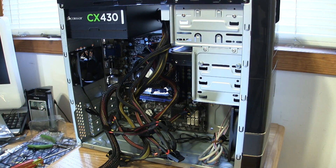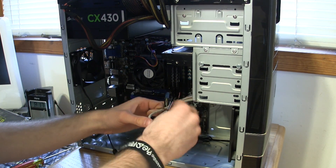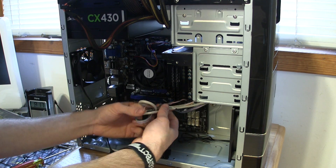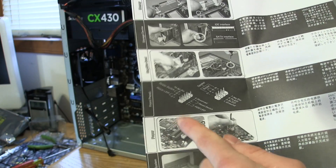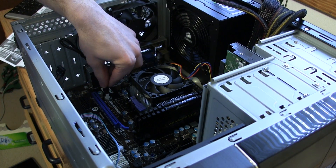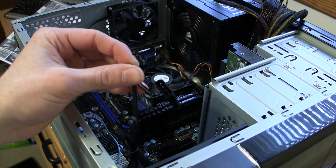Once that's done, you're going to have a giant mess of wires. Before wiring all the power, look at the wires below that are part of the case — these are the wires for the USB ports, audio ports, and the power and reset buttons on the front panel. Wiring these can be tricky, so you'll need to look at your motherboard's manual. Finally, before wiring power to the motherboard, plug in the fans. There are two fan sockets available — just look because they are labeled.